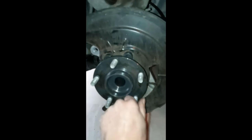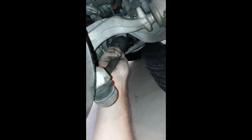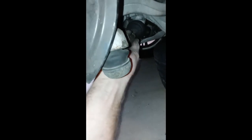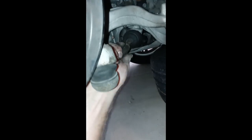We're pulling off this Infiniti thinking the wheel hub was bad, but I'm turning it and I don't hear any noises, so maybe it's not bad. Something we didn't check before — tie rod. When you want to check for an outer tie rod, you do this: there should not be any movement. That is a massive amount of play. The other cars I've had with this amount of play, when I replaced the tie rods it got better. To test for inner tie rod, you grab it here and pull — I don't see or feel any movement there. So I think the outer tie rod is bad. You have 3,000 pounds of car on top of this, which explains why this side has been riding rough and handling a little sloppy.